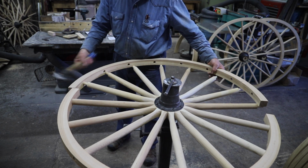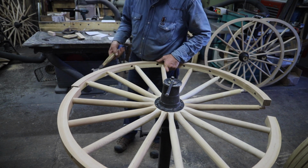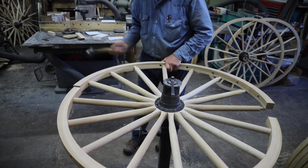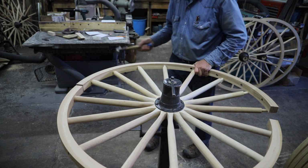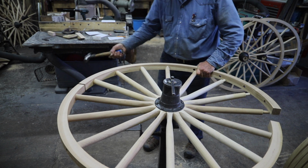So for this second half of this wheel, I'm going to leave it speeded up just a bit, and I think you can see the process where the right side is not outside of the spoke ends yet, but you can see it relax and start to move out. I'm pulling it out with my left hand as also I am pushing the spoke into place.